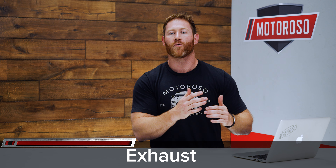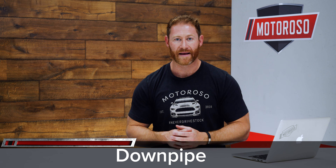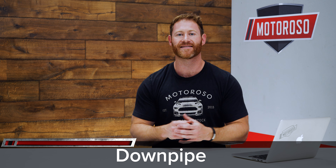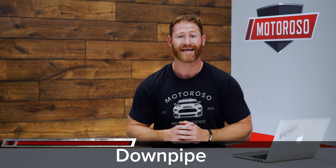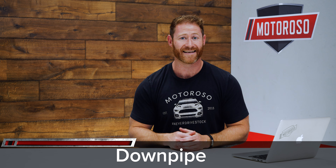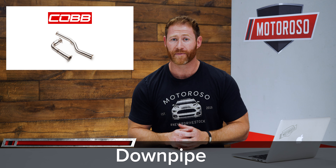We'll be making a separate video all about exhaust systems for the WRX FA20, but here we're covering the biggest bang-for-the-buck items. That starts with the headers — you'll be deciding between keeping the classic Subaru rumble with unequal length headers, or boosting low-end torque with equal length headers. Either way, you're getting more air into the turbo and a major bump in horsepower. Further down is the downpipe, also called the J-pipe, which helps exhaust gases exit the turbo much more quickly, unlocking hidden power in the low end of the power band.